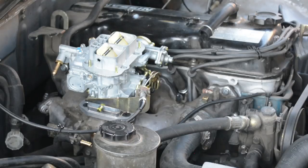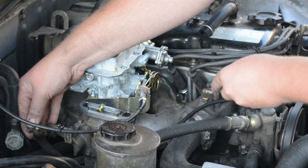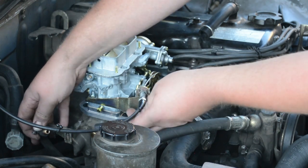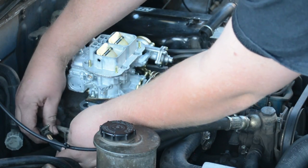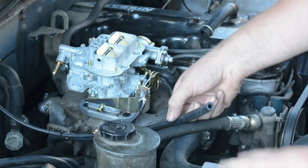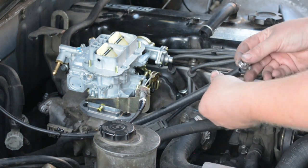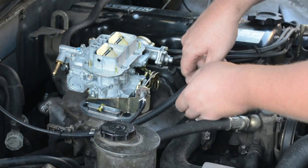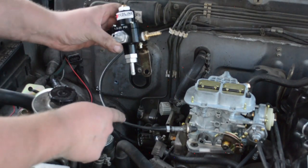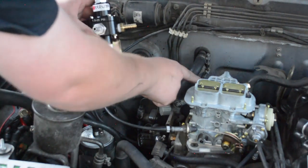Sounds like it should be a good idea to transition this valve that has some coolant, or the hose, I mean, and then this port also has coolant. So we're just going to, we got a split splice barb fitting to put onto here. Like that. Throw that over there like that, and grab this one, like so. And we will push that guy into here. Another barb. This is our return, so that'll be going to the return line. We're going to make this one our inlet from the fuel filter. And then this one's going to go directly over to the carburetor.